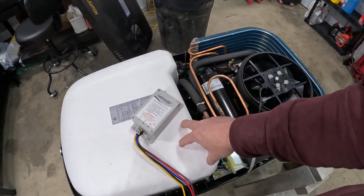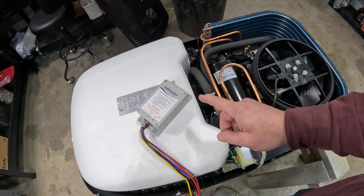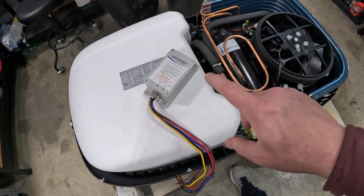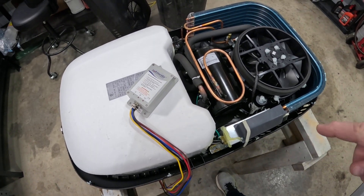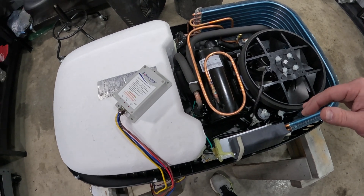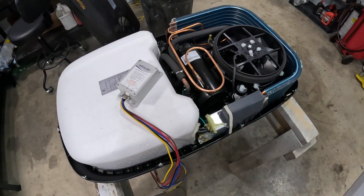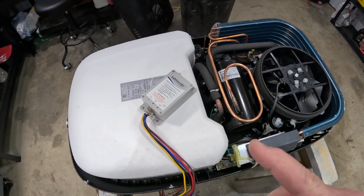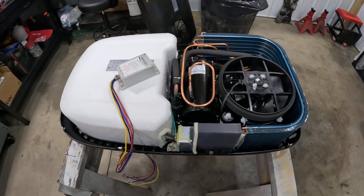If you want to see how I installed this unit — in this case it's a SoftStartRV — Micro Air makes another good one. I would probably avoid the cheap $100 ones you see on Amazon; you do get what you pay for, and these come with a nice warranty. Either this one or the one from Micro Air, there are a couple others out there that are decent — that's what I would stick with. I have another video posted previously showing the exact same installation, with a link in the description below. I just want to emphasize why it's important to use a soft start when traveling in a van, whether you have AC power via a small generator or an extension cord. It will make your life a lot simpler, it's worth the money, and it's way easier to install before you get the air conditioner put on the roof.